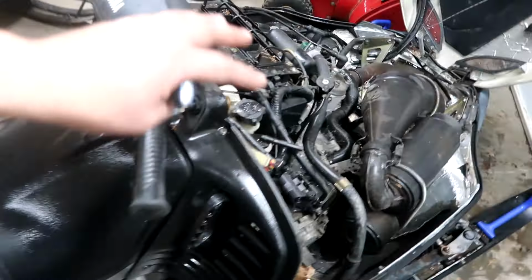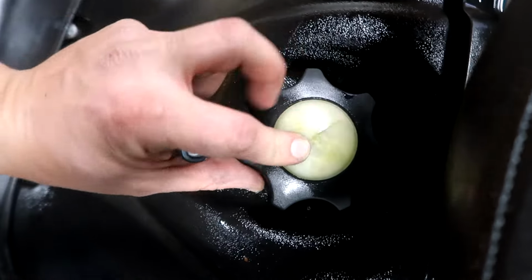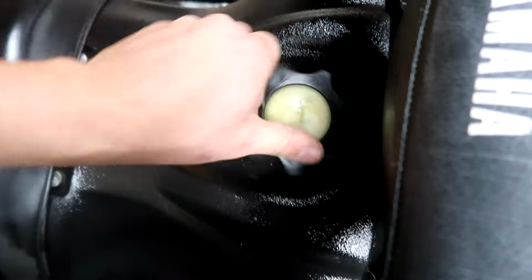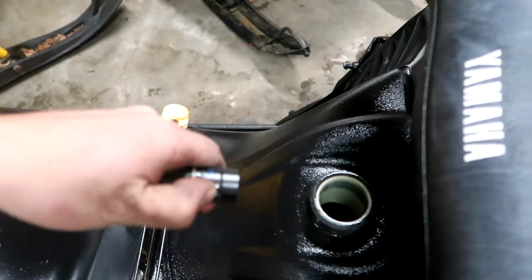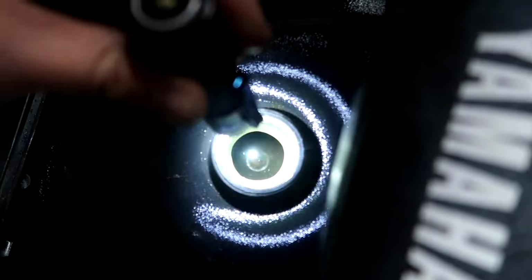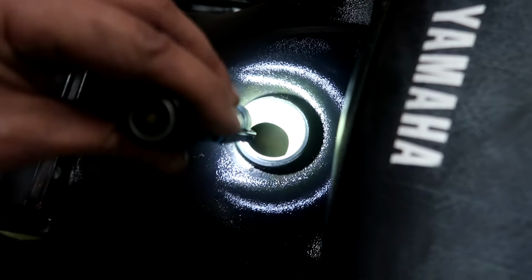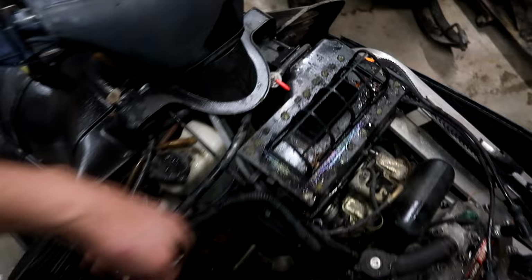So now I'm looking it over, seeing a few more things. The first thing that I noticed is this crack on the gauge right here. And if we pop it open, I can almost guarantee you we are gonna see some water sitting in the tank. Oh yeah. Oh, that's ice. Legit ice, man. And over the course of 8 years, it probably just dripped and dripped, creating a nice pool. I did notice they had the gasoline line shut off, which is great.